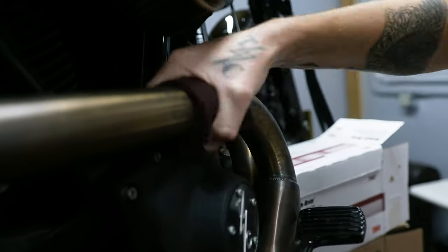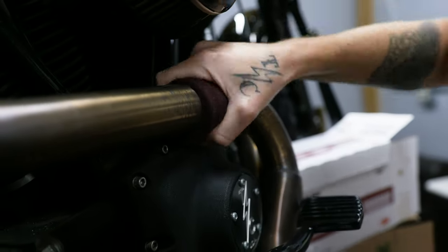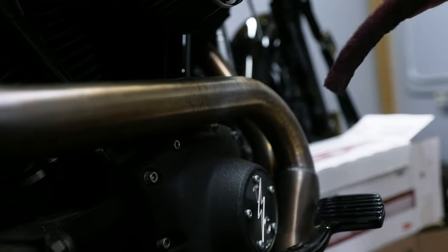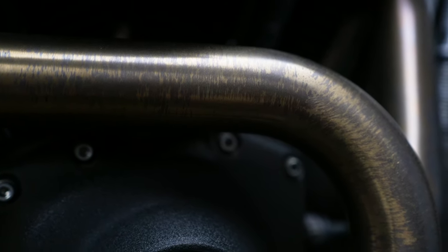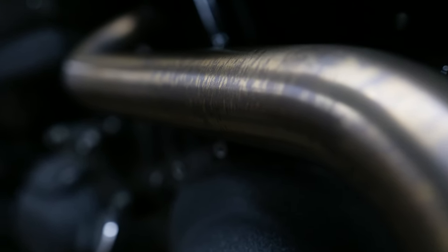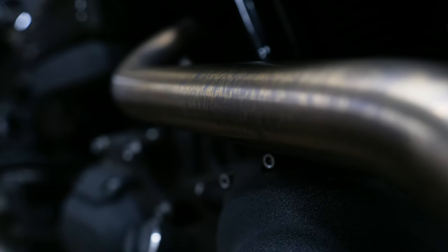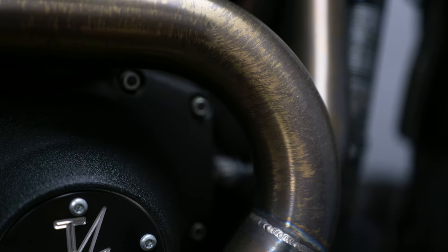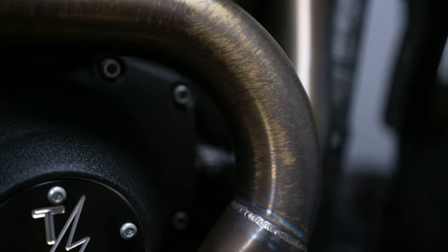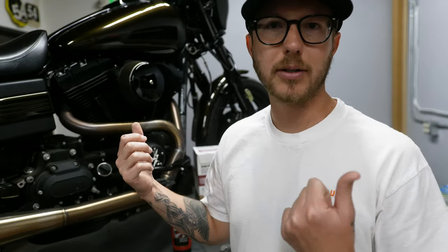You can already see it coming off a little bit. The exhaust can tarnish and what we find is it's usually road grime — it could be detail spray that accidentally dusted off your tank onto the exhaust and then you start it without realizing it's there. It could be your foot touching the exhaust leaving rubber on it. Stuff like what we're seeing here we chalk up to something off the road. It burns in as you ride, as the pipe gets a couple hundred degrees, and it kind of gets into the metal — that's what we're going to rub out.